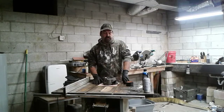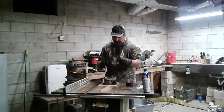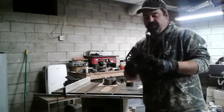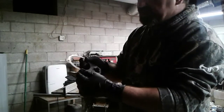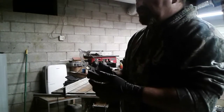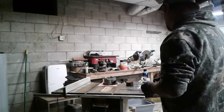Normally that's a blown head gasket. Well, in this case it's a blown head gasket and a warped head. This is a pretty old engine and this is the original head gasket, and as you can see it's pretty well shot. The reason why it was messed up and warped is because somebody way over-torqued the head.